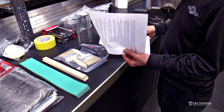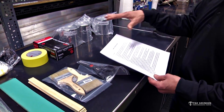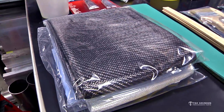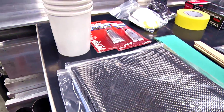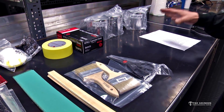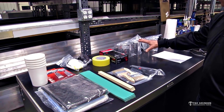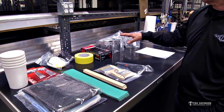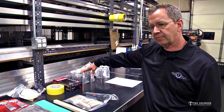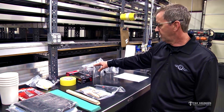All of the kits we sell come with a nice set of instructions. If you take a second to read them, it will give you an idea of how to use all the components to properly repair the body at the track or at your shop. Sometimes you need to use it at the track if you hit a foam block or bump into the back of the trailer. We're going to use a vinyl ester resin in these kits — if it's a carbon body it'll be made with epoxy resin, if it's fiberglass it'll be made with vinyl ester resin. Vinyl ester and epoxy are compatible materials.